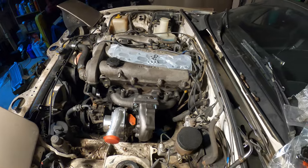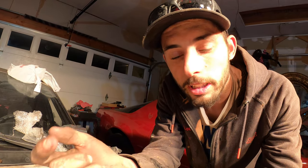Right now we are going to jump on to draining the oil and doing the oil return into the pan, just because that's something I want to get out of the way. We are going to do that and then we'll work with the oil feed while we have the oil drained out also. That one is going to be not fun at all — it is on the driver side of the engine underneath the intake manifold and I can barely see it. I'll show you the adapter I got that threads in between the sensor and the block and then has a threaded hole on the side so you can thread your oil feed into it.